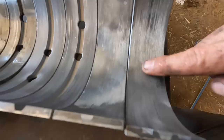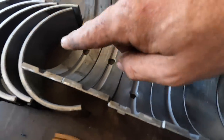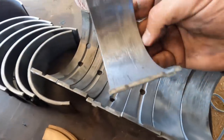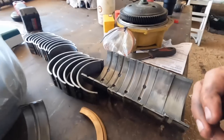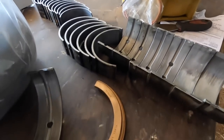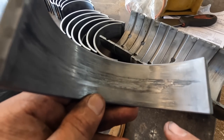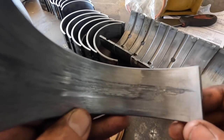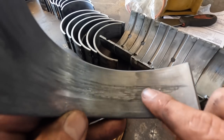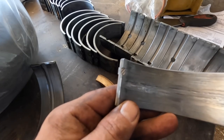So typically, that bearing is not too bad — just used, but okay. Just wear and tear a bit. But we picked up this one here — that makes it worthwhile. I'm glad we did it. You can just see in there, it's actually just starting to pick up the white metal a little bit. So it's a very good move doing the bearings.